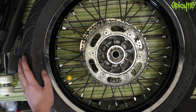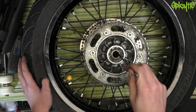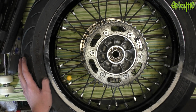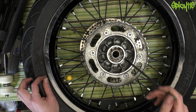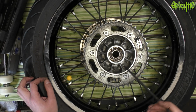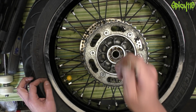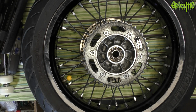So I popped down to the local garage and said, hey, if I brought you in a loose wheel and 3 bearings, how much would you charge me to just pop those 3 out and pop the 3 in? And they said 30 quid. And I said, I can buy a tool for that, thanks very much. So I've bought the tool and that'll be here Saturday. That basically is just a slide hammer and a thing that will catch this edge and I can bonk them out. Bonk them out? Bonk them out.